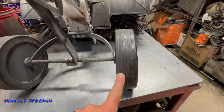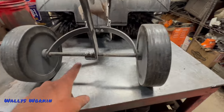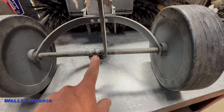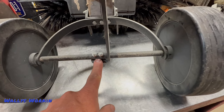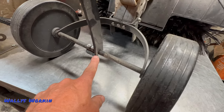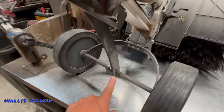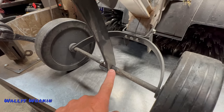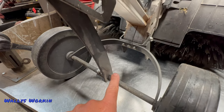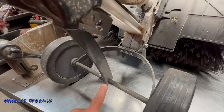The wheels will get loose and start getting all cockeyed. There are two bolts right here that will loosen up as well. Occasionally you'll see this adjuster bracket snap off right here around this tube. We've had to re-weld several of these or just replace the entire thing.